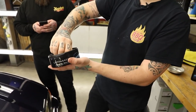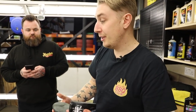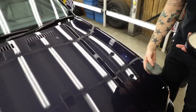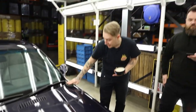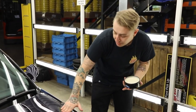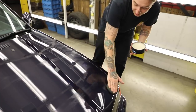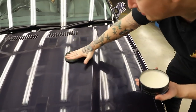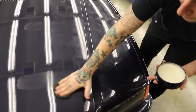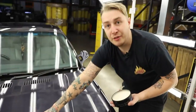Pinch the top, place it on the wax, turn it half a turn — this is enough to do the whole front end of your car easily. So less really is more. When waxing a surface, break it down into halves. Draw some lines like this, and then in one pass go over each line. This makes sure each surface has got an even spread of wax. I'm not overworking it in — once I've passed over once and it's got an even spread, I stop. And use a circular motion rather than the hashtag effect, because we're not working the surface, we're just applying.